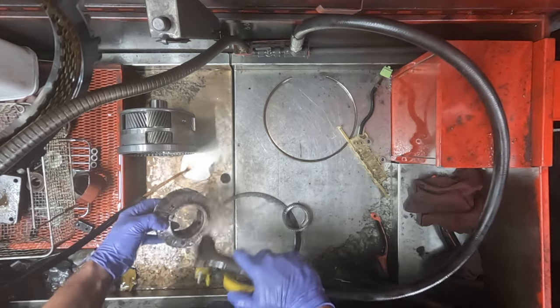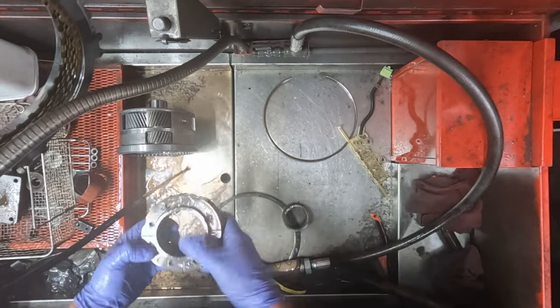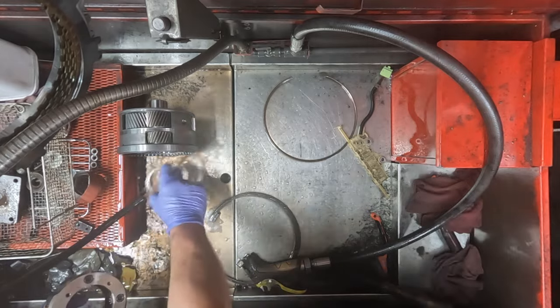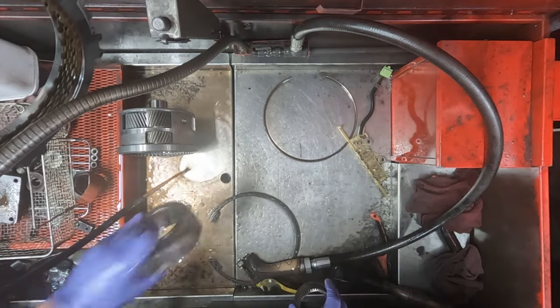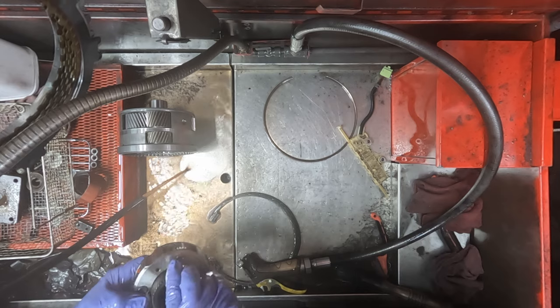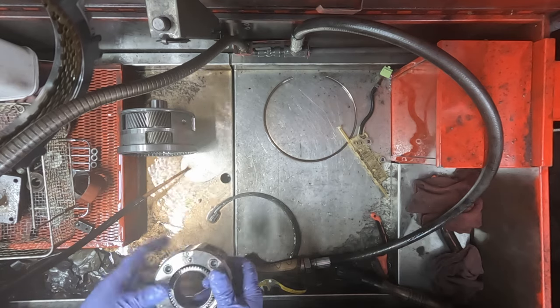And if there's a little bit of mineral spirits residue left in there, it's not going to hurt anything. It's going to dry out. It's not going to leave anything behind like the soap would, because the soap can actually act as an abrasive if you don't get that soap film washed off of the parts, and we don't want abrasive in there.